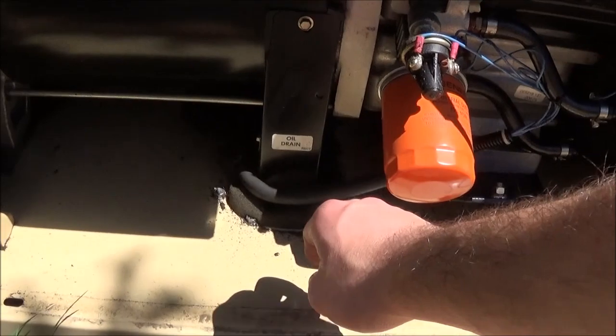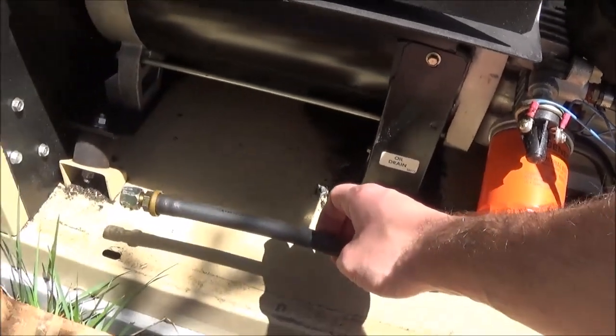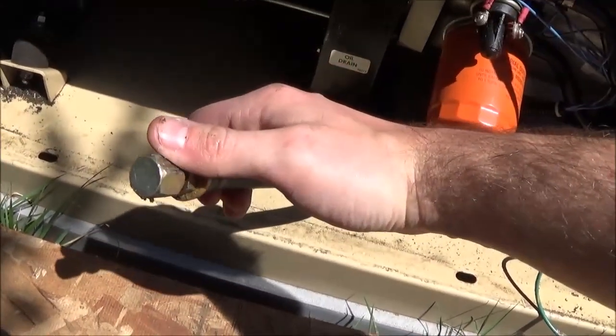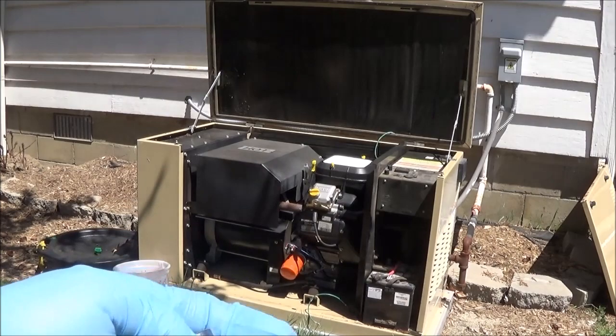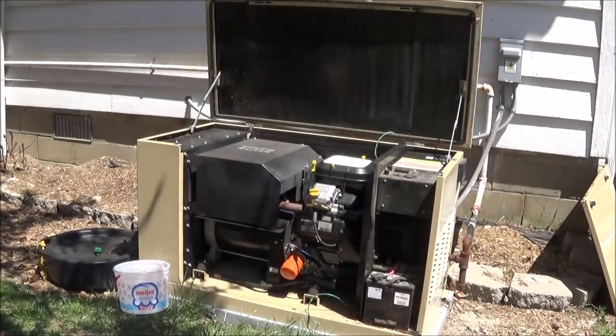You'll see there's an oil drain hose right here that's clamped in. Just kind of lift it out of there — there's the end — and take this nut off, and then you can drain the oil out. For the oil hose, you're going to need a 5/8 wrench and an 11/16 wrench to twist them.